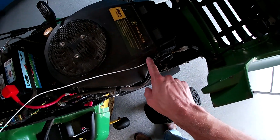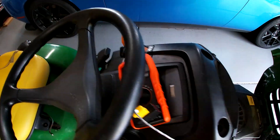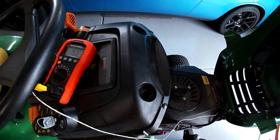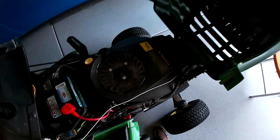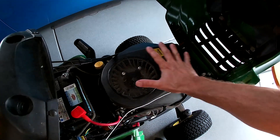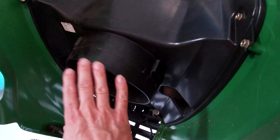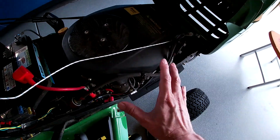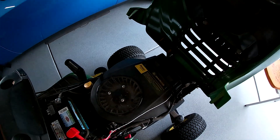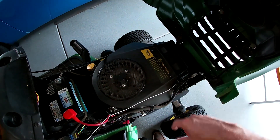I've got this thing back together. This thermocouple wire is just long enough — I can close the hood and see the readout on my dash. I'll zip-tie the multimeter to the dash and read it while I'm mowing. I'm guessing it'll stay fairly cool while it's running, since this is designed to draw air in through the plenum in the hood and blow it out the bottom. But after it shuts off, we'll see what happens.